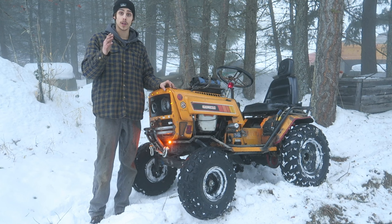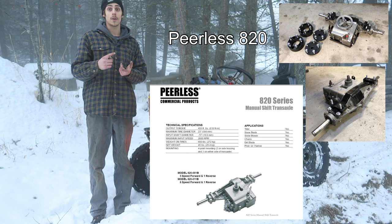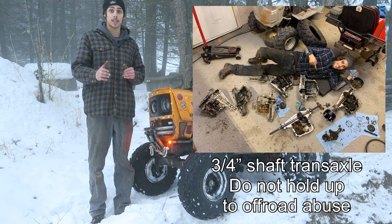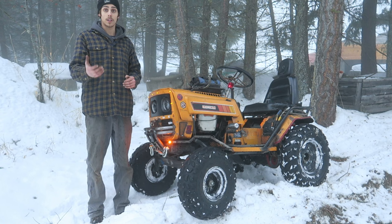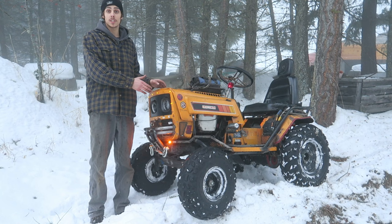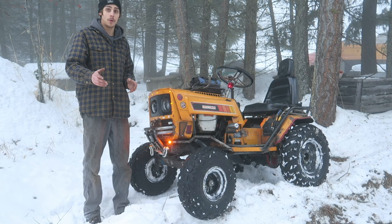After years of running Musty with the 1200 I realized I wanted a different gearing reduction and another gear to get my top speed higher and my low end more torque — putting the Peerless 2300 in worked great. Look for one-inch axle transaxles, meaning the axle shafts are one inch in diameter. They're beefy and way more durable than the three-quarter-inch transaxles. Garden tractors are just beefier overall with bigger engines, heavy-duty transaxles, and better steering systems.